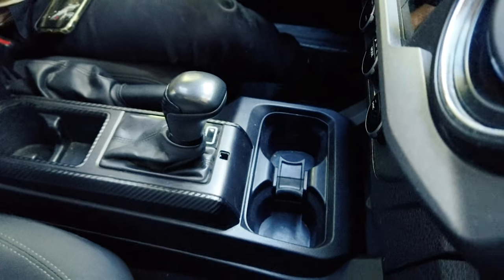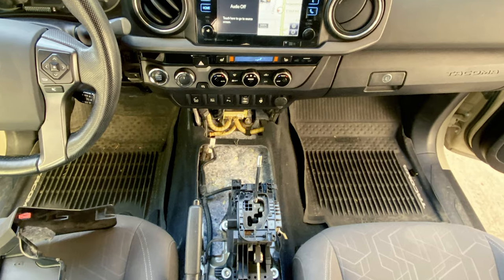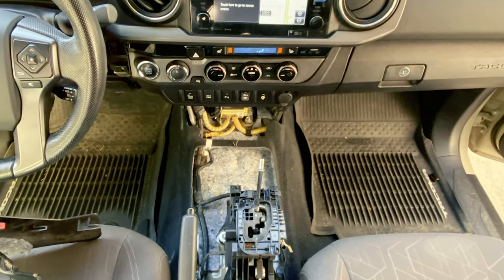Once I got all the seats back in the car and reinstalled all the rest of the airbags, I thought I should be good to go — but that wasn't the case. The issue was that the airbag control module was still showing that the airbags had been fired, and because of that, it was telling the ECU to keep the airbag light on. So I had to take out the airbag module, which meant removing the whole center console and charging tray, since the module sits right underneath. Every airbag and seatbelt in the car is wired into this module, and it tells the computer there is a system fault unless it's been reset after a crash.